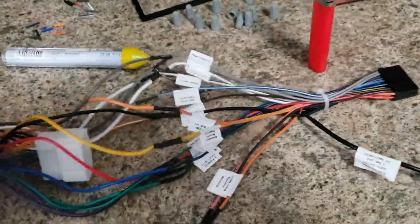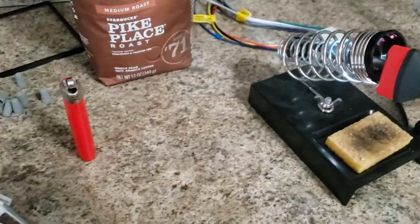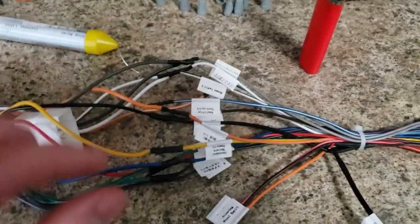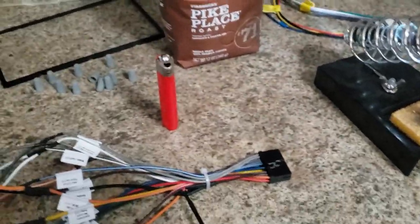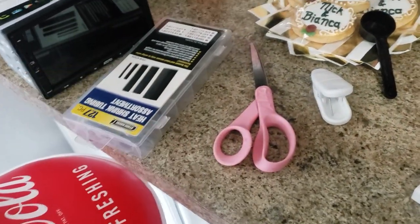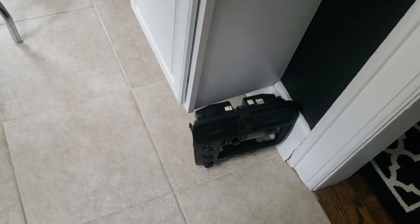Here's the completed wiring harness. I don't have to worry about it falling apart or the wire nuts coming off. You don't have to know how to solder to do this — you can use butt connectors instead with a crimp tool, and that's another acceptable method. I like soldering the best because it takes up the least space, looks the most professional, is the most permanent, and is the cheapest. Solder itself was $2.99 and heat shrink is about $4 at Harbor Freight. This is done — next we're going to go ahead and put the radio into the HVAC radio center console.